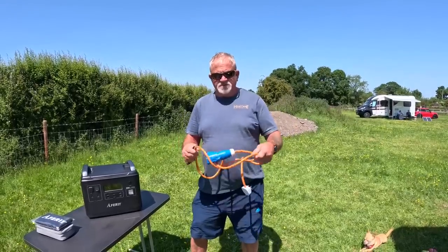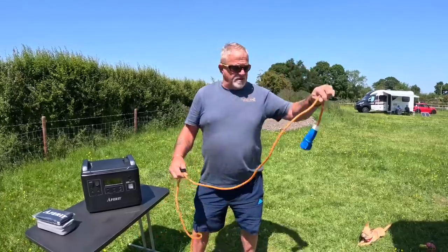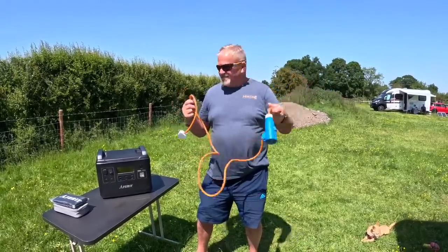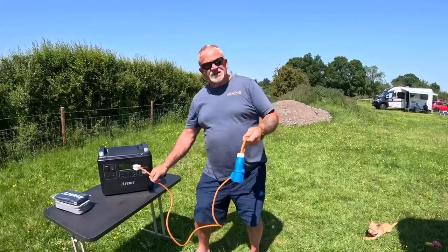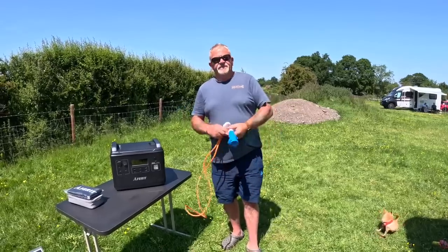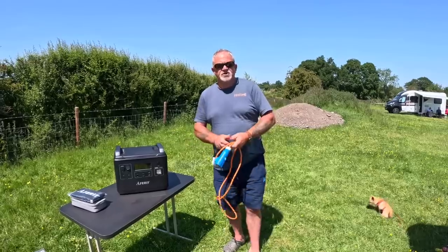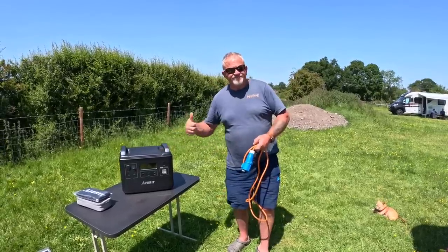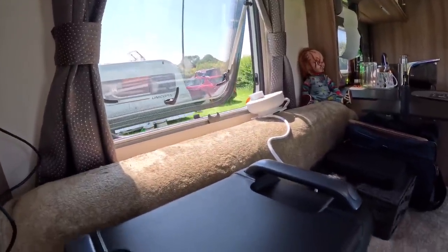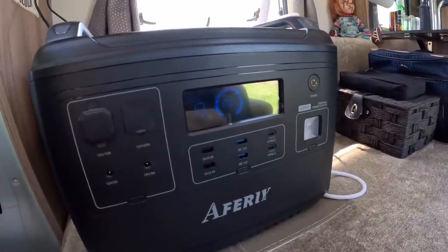So what we're going to do now is plug this into the van and leave it plugged in until it dies. I've made this cable especially so I can plug the van into it — that plugs into there and into the van, so the van thinks it's on hook-up. That means we can have the lights, the telly, everything on as normal. Right, so I've got it plugged in — the wire wasn't quite long enough but it's on an extension lead now. It's going to last 13 hours and the van is taking out 65 watts, which is probably the onboard charger.